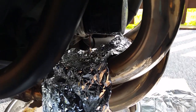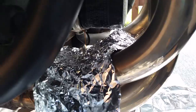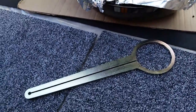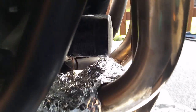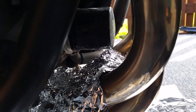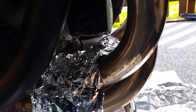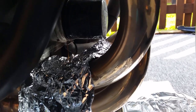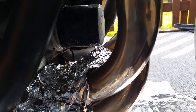This is the oil filter, just draining the last of the oil out of there before I finally unscrew it and take it out. There's the wrench I used — not a lot of room in there, quite tight, you have to make small regular movements with it. Got it undone and the exhaust is still a little bit warm, so I'll give it five minutes, go have a cup of tea, come back and then hopefully get my hands in there and take that out.